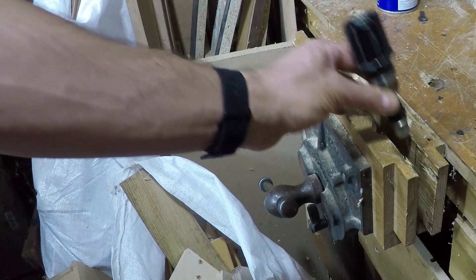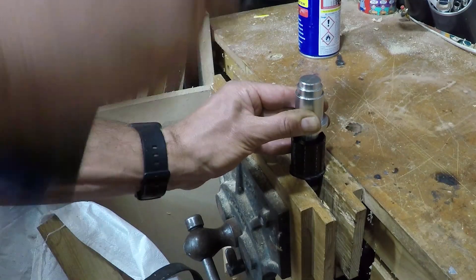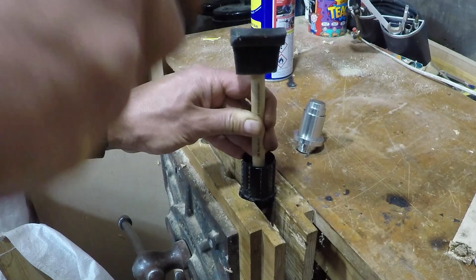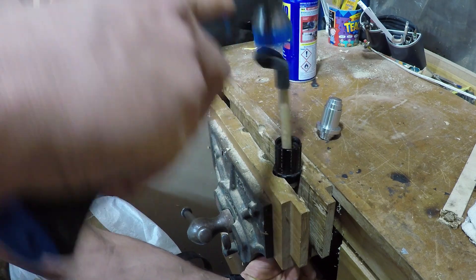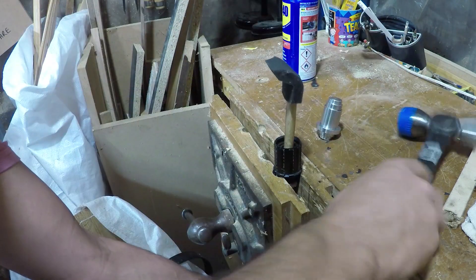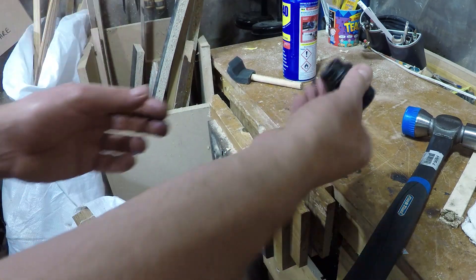If that fails you'll have to tap out the axle with the free hub body still attached from the non-drive side, then resting the base of the free hub in the soft jaws of the vice to tap out the axle. If it's really seized in there you'll need to find something soft, just less than the diameter of the axle to punch it all the way out. I'm using the handle of a foam brush that fits perfectly.